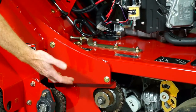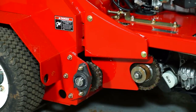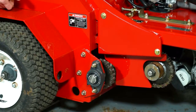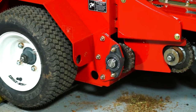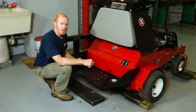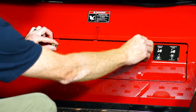From this chain we run back to a jack shaft that has a chain coming from the jack shaft back to your rear tires, and then one inset that runs from the jack shaft back to the tines. You also have a pillow block bearing here that will need greasing routinely, and several others that will show on the inside of the machine momentarily.